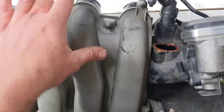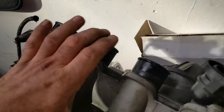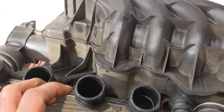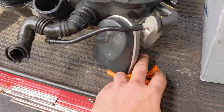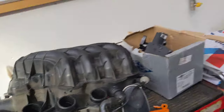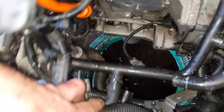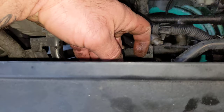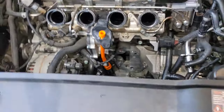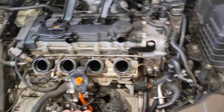You also have to release the EGR pipe completely — I'll show you on the car. There are two nuts holding this down. For the front bolt you need a quarter drive long 10mm socket with a universal adapter. Also get the dipstick tube as they're designed to completely crumble. You go down from here and there are tabs on this hose that make it impossible to get any tools on there, so get your quarter drive set with a universal.